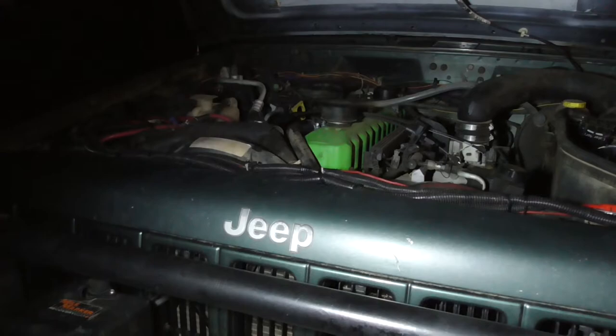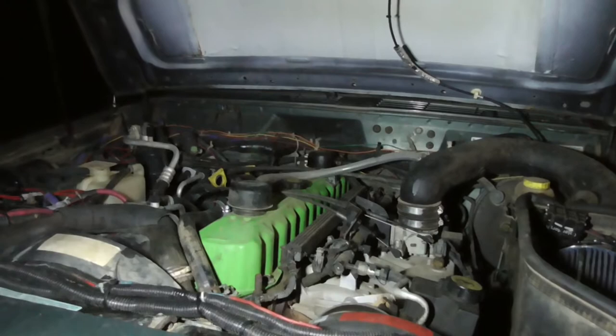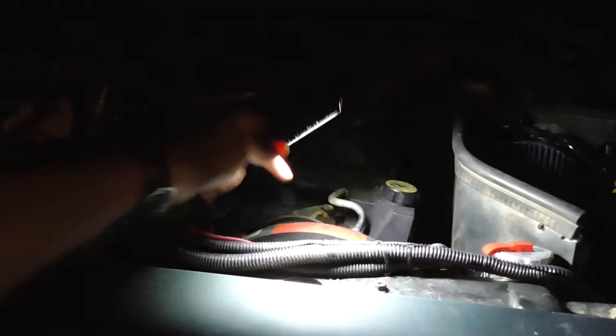Same thing on the Yukon. At some point, I'm going electric fans on the Yukon also, and that will help a ton. With the AC on that thing, it's not very sporty anyway, considering it's a big truck and it's lifted. But you can tell a difference when the clutch fan kicks in on the Yukon. It's outrageous how much power that clutch fan robs. It makes sense, because the only fan on that thing is a clutch fan. There's no auxiliary cooling fan like this one's got.